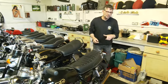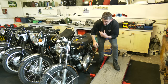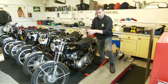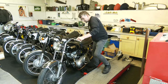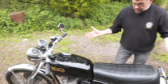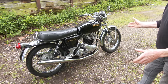So we're going to push this one. It's a little bit different - it's got a Mikuni carburettor. We have had it here before and fired it up. It has a cold start choke lever on the carburettor that will make it run slightly fast. When I fire it up it will run fast and I'll take the choke off. It makes it a very economical bike with a single carburettor. This is quite a common thing people do - they don't want the hassle of two carbs, keeping them in tune, cables coming out of adjustment. One carb, one cable - it doesn't get any easier. Quick reference - this is a 1972 Roadster 750. The customer has taken the indicators off, which is quite nice actually. He's got a Mikuni carburettor instead of the twin concentrics.